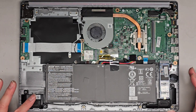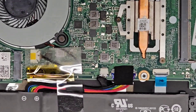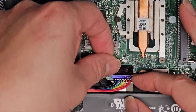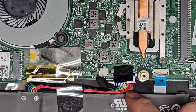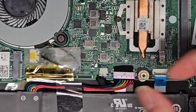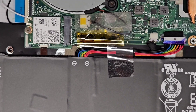Let's go ahead and pull the battery out. We're going to carefully peel this tape up. Here you can see the little connector — I use my fingernails at the wings of the connector and wiggle it. Take note: the red wires go towards this connector and the black wire goes towards the larger keyboard connector. We're going to pull that out. There's also a spam call going on — let me cancel that.